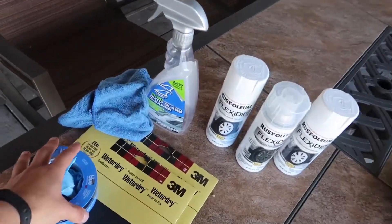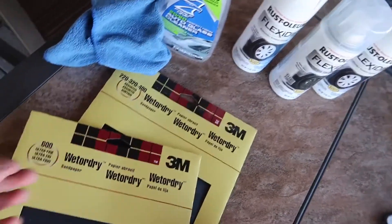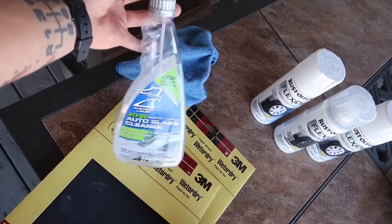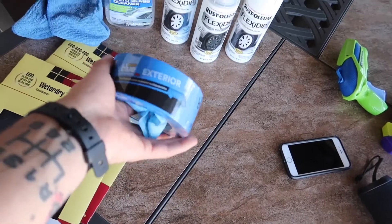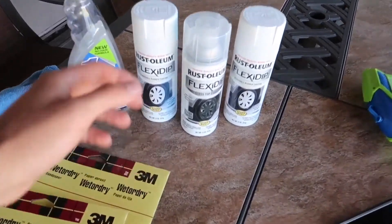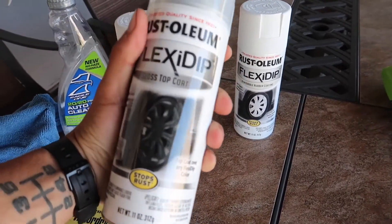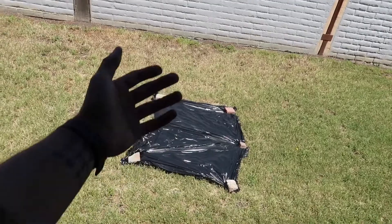Here are the materials we're using today: 600 grit sandpaper. I bought 240 to 400 but I won't need that since the scratches aren't super deep — 600 will clean it up. We're also using a water-based product to first clean the surface of the wheel before sandpaper, then after to remove debris before painting. We'll grab tape to wrap around the tire so there's no overspray on the tire. We're using Rust-Oleum Flexi Dip in white — two cans, about seven coats — then a clear coat to protect the paint. I grabbed two plastic bags, opened them up, grabbed some bricks to set the wheel on.